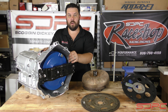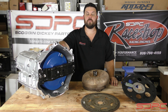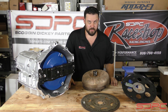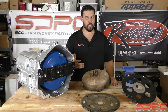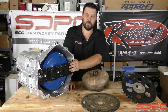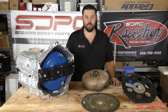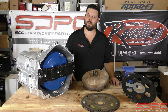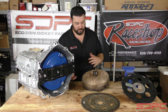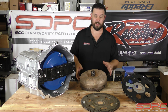As you can see here, this is a six-speed automatic that you would find in an LS3 6L80 application. We're actually using this in a future project, so please stay tuned for that. But for today's purposes, we're going to be using it for educational instruction. Now when you get a new transmission from Chevrolet or Chevrolet Performance, they do come with one of these retainer plates here in the front. You can see the blue torque converter, but you see this retainer plate — it keeps the torque converter from falling out during shipping. They're also pre-stabbed from the factory, and that's a really good thing because that's where a lot of problems come up. I have an old 4L60E torque converter here I'm going to be using for demo purposes — this thing is no longer road worthy, it's pretty old and junked, I'm saving it for a core.